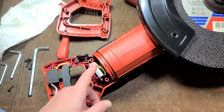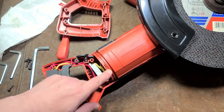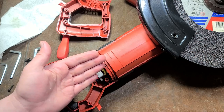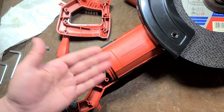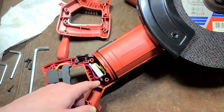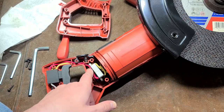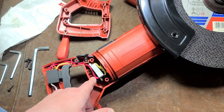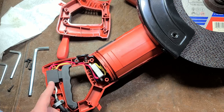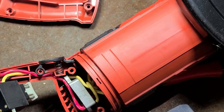After looking at the gearbox, I did want to look in the handle. They have these wires kind of pre-twisted, and I understand that they actually have a stop, so the handle can only rotate 270 degrees. It can either rotate to the left, center, and to the right. So that prevents you from just spinning it all the way around, pulling out the wires. The wires are indeed 12, it looks like they are 12 gauge. Internally, they just use a 14 gauge power cord, which is just totally bonkers.